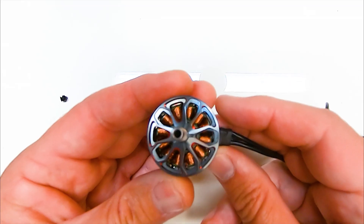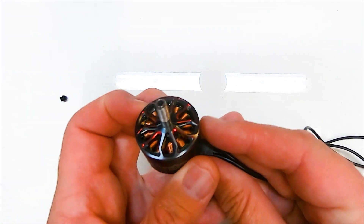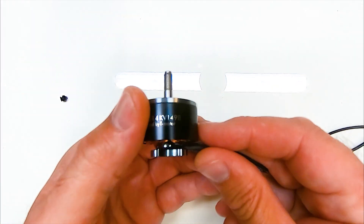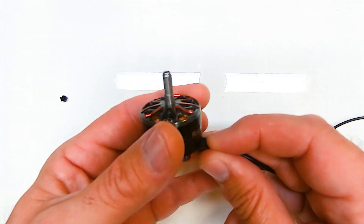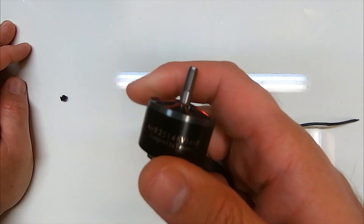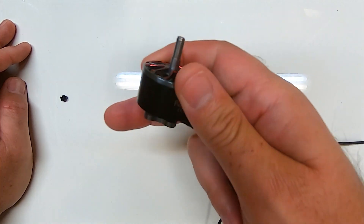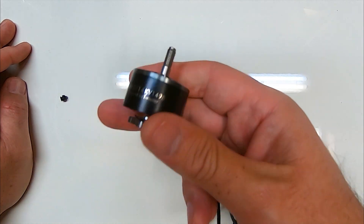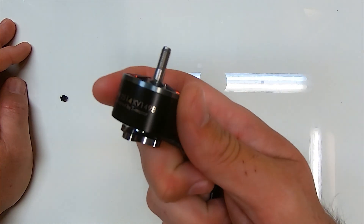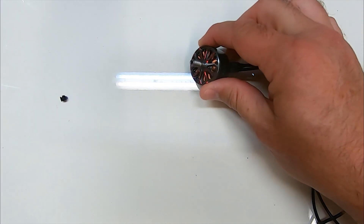This is the motor for someone running a seven, eight, or nine inch quad, possibly on 4S or 5S. Because it's such a big motor it will have loads of low-end torque, and because we've got a very tall stator as well it will also have a lot of top end. My plan originally was to run this on 6S, but that might be too much power — although I'm going to give it a try, since this is rated up to 8S. You could make it an immensely fast quad spinning seven, eight, or nine inch props on 6S or 7S.